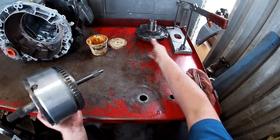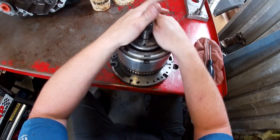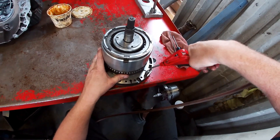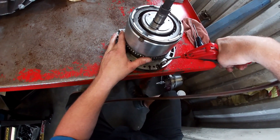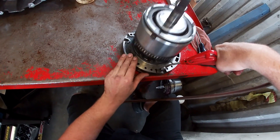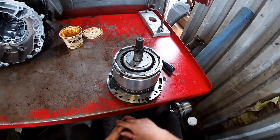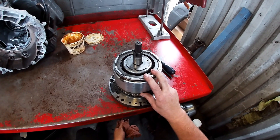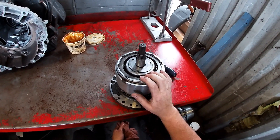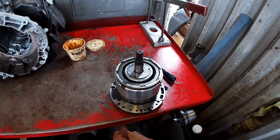Our last step: put our pump assembly down, making sure we have the input bearing in place, and we'll pneumatically check it. Taking our air gun and making sure we're at 30 psi — we're running 90 at the shop. We have underdrive, overdrive, and then last reverse. That is a successful overhaul of this input assembly. In the next video we'll tackle measuring the clutch pack clearances with a dial indicator — you normally need to do that if you have a rebuild that's really far out or you're starting with new baskets or a hub assembly to make sure you get the clutch clearance correct. Then we'll start tackling the braking clutches, the valve body, and the compounder assembly from the case.